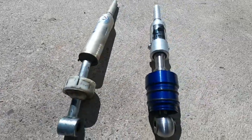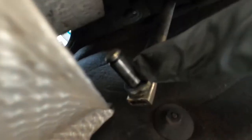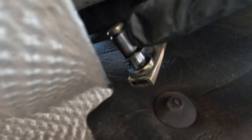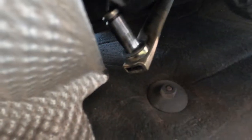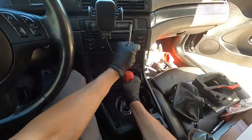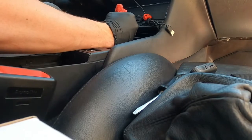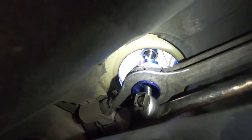Now to put the new one in. The washer that was on there, and then the shifter, and then there was another little washer that goes, and then you put the lock pin there too. Lining this little pin up back with this, let's get it back through. I'm gonna get this little spacer back on and that clip back on, but I don't think I'm gonna be able to hold the camera and do that. So I'll bolt it up with the washers on each side, let's go back up top and see what else I gotta do.